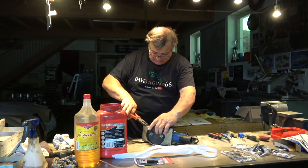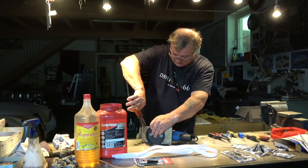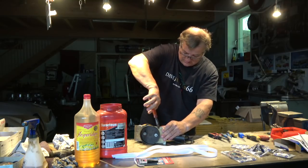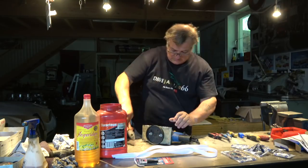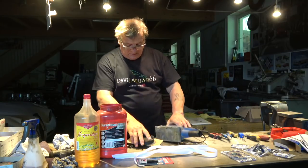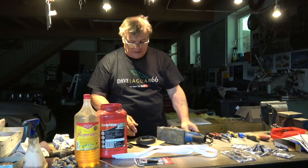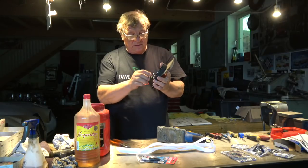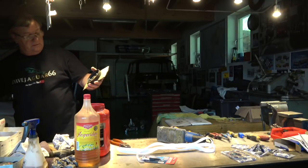So I'll just take off this piece of metal, because obviously with the metal it's vibrating and makes a bit of noise. I'll take this off and show you how I did it. This is a piece of scrap plate I had. You can see there's the original pad here, and I just made this little piece of metal to go over it, because, as I said, there were no clips. I just bolted it on with a 10mm, so I'll take that off.